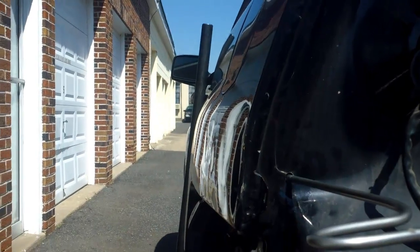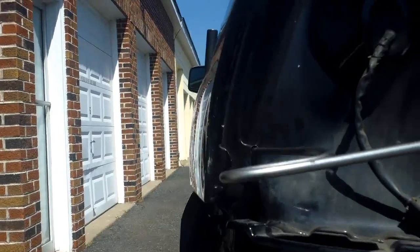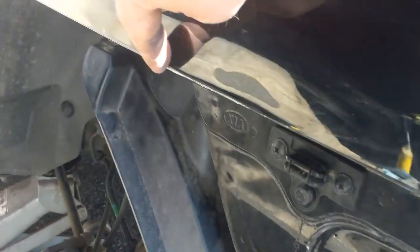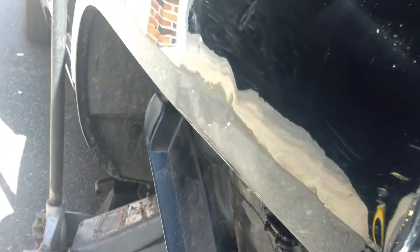You see, I try to get it close before I start knocking it down. It's really ripply now. I'm not sure if I should take it any further, because regardless, I got to paint it. And it's creased real bad right here, right along this bottom. This is what's fighting me so much. I didn't want to go drilling holes, but I don't want to pull it out too far. So I think I'm going to hit it with a block, just to see my highs.